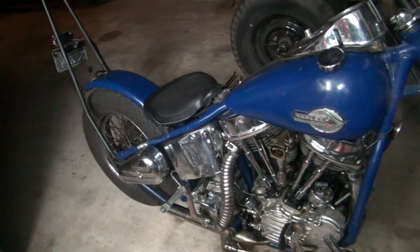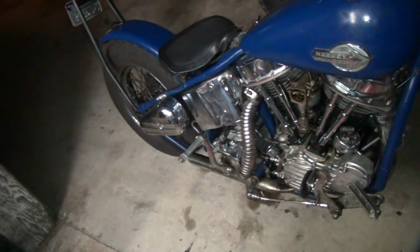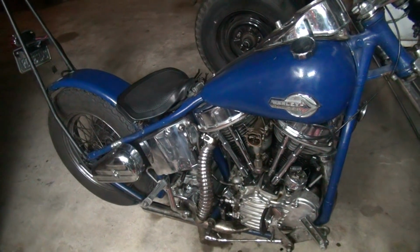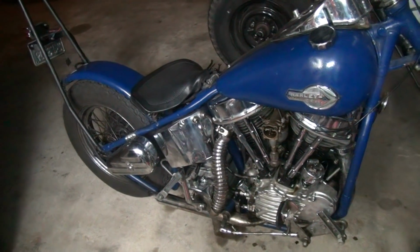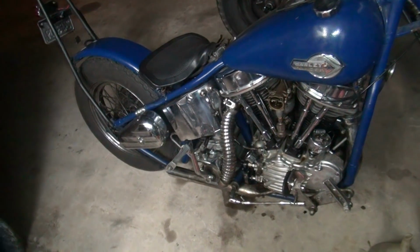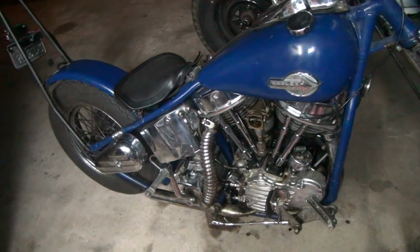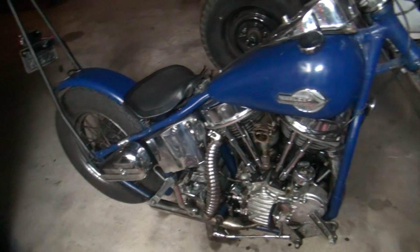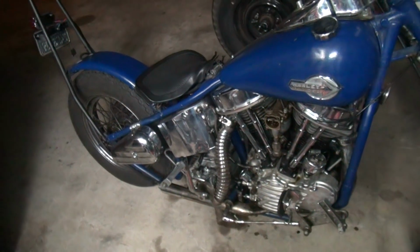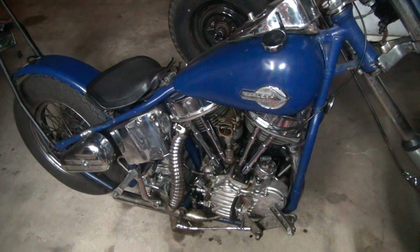So we're going to put some gas in it and see if it'll make the carburetor work correctly when you've got actual fuel in the motor. My guess is there's still something going on with it. But at least the mechanical of the motor's good. It's just now we got to figure out the carburation issue and fuel flow issues and other issues. But at least it idles when it's got fuel in it. Starts up really nice, as you can tell, which is good. It runs on 2 cylinders. All those are pluses. So adjusting valves, timing, all that other stuff we did works great. It's just a matter of getting the carburation figured out. All right, we'll get some fuel in. Let's see if that does the trick.